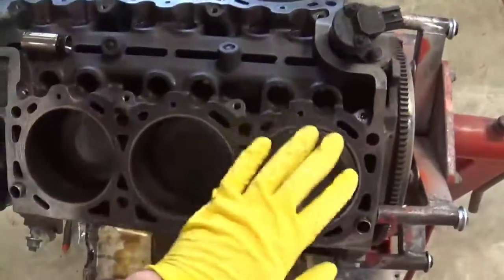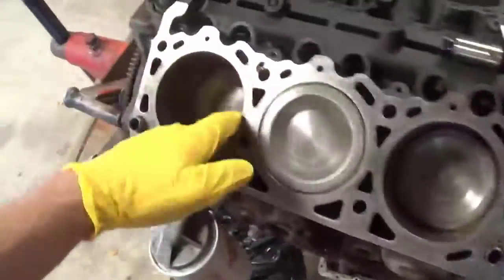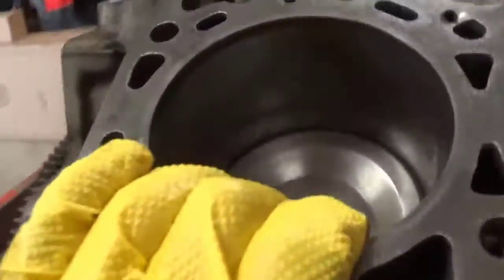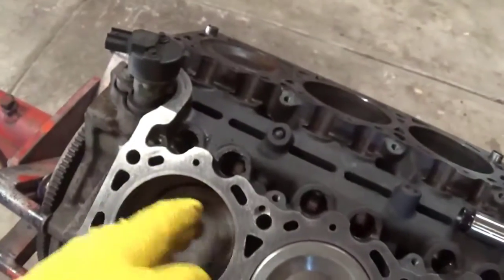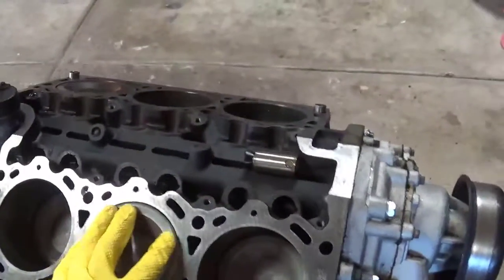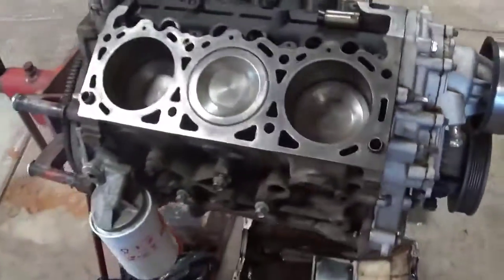And then looking at everything, the cylinder walls are pretty good. This side isn't clean yet. This side is. They're actually not bad. There's a little bit of rust forming on the top of the bore because I washed it off and it kind of sat there. You can kind of feel it, so I can ignore that and it won't be too much of a detriment, but being 200,000 miles, I'm probably going to do a refresh, new rings, bearings, and rehone the cylinders on this.